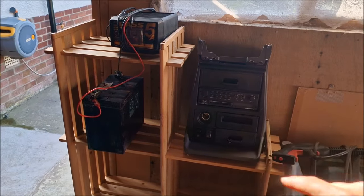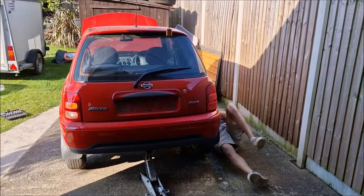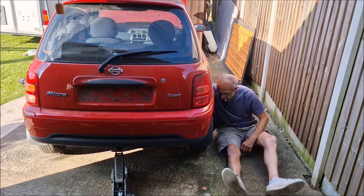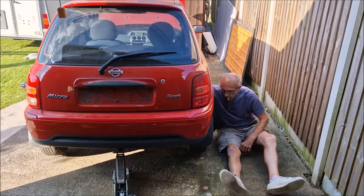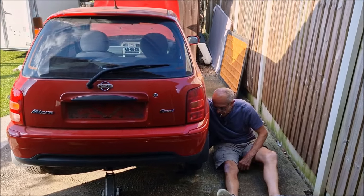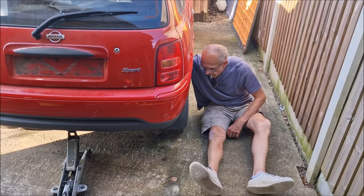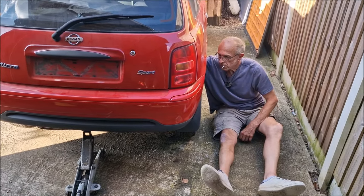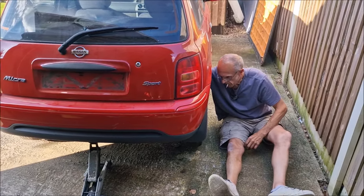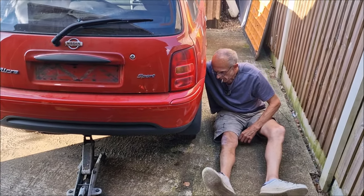Bonus Proton centre console content! I've found a bit of rot — it's not structural, but there's a bit of rot in the back here behind the wheel arch. A small person could get their hand in it. What are we going to do with that? Patch it. It's not structural — it's too far away from everything. It's just inside the wheel arch there — it needs doing. We could just weld it in and spray it.